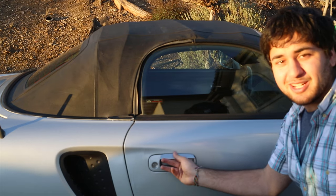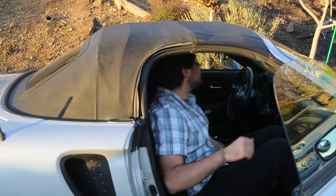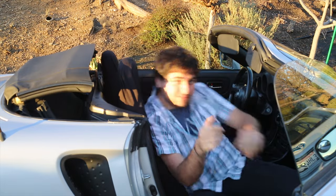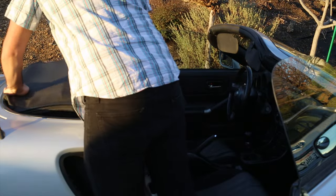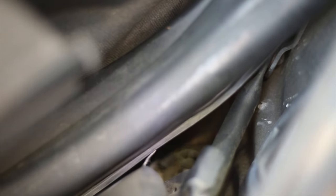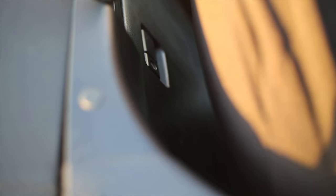First, you're going to want to lower the soft top, and then I'll show you what the drains look like — at least my dirty ones. You can just barely catch a glimpse of the drain down there. There's a bunch of debris, and if that gets into the drain, your soft top drain won't be draining properly outside the car. Instead it will back up into the rear compartments, so it's best not to let that happen.